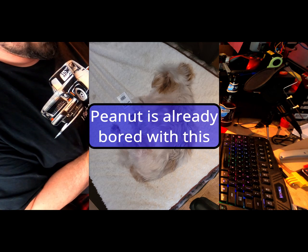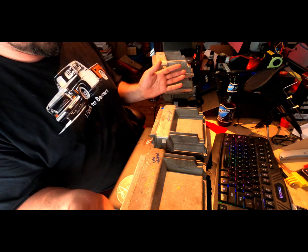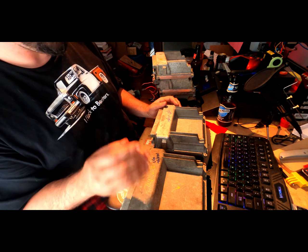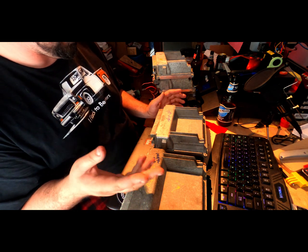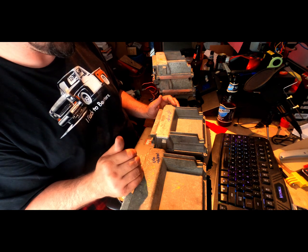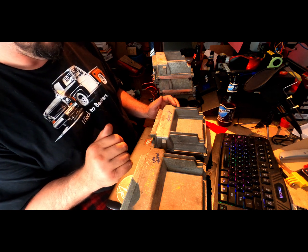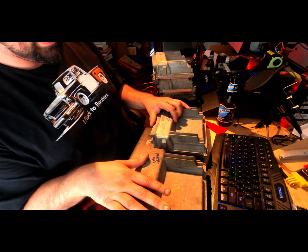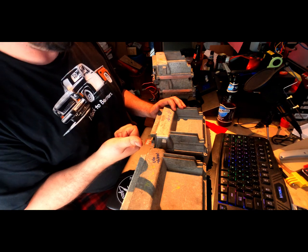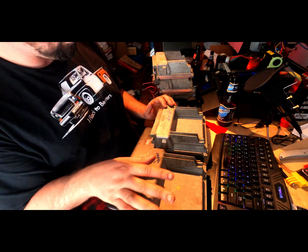You can run flex fuel without a content sensor — you can just say I'm only going to run E85 ever, and simply tune a non-E85 OS for E85. Or you can add a content sensor and do that on either one of these PCMs, adding an OS that is flex capable. You have to find an OS that is flex capable, and if you want to do a 4L80, you have to find the right segments. For that, we'll go over to the computer.